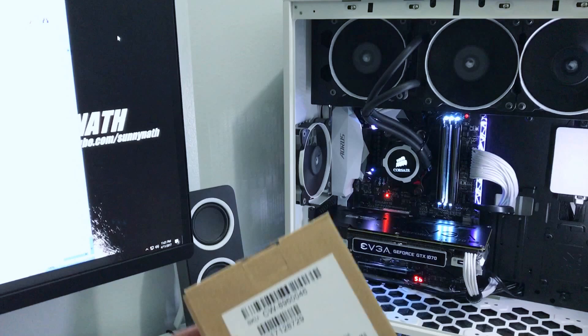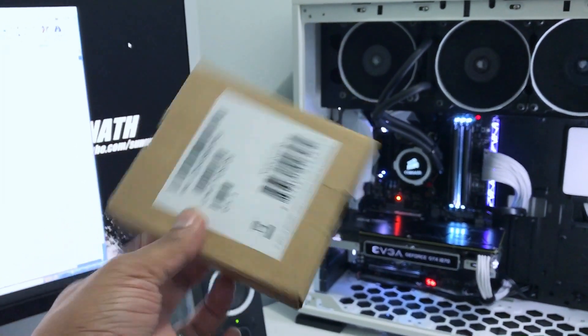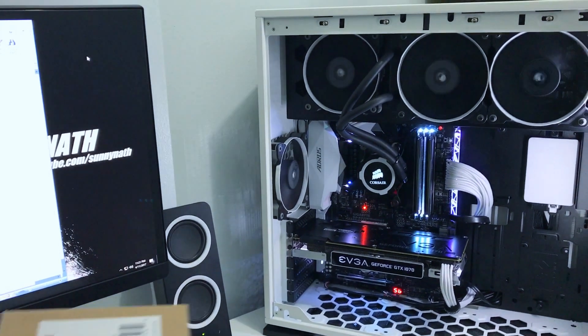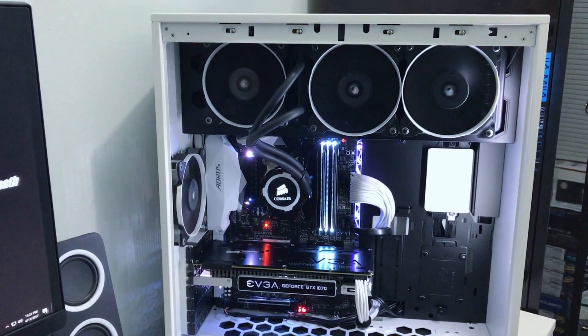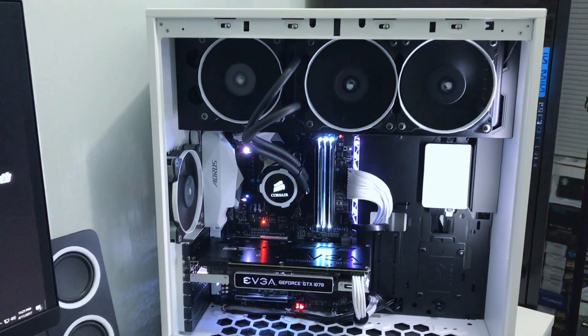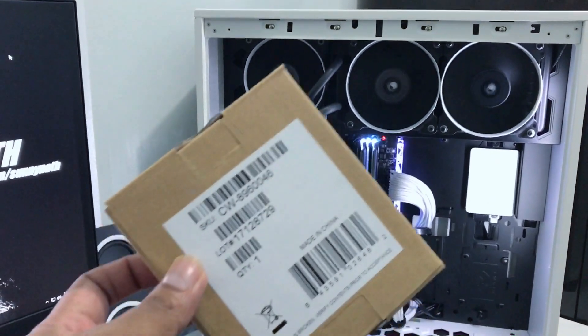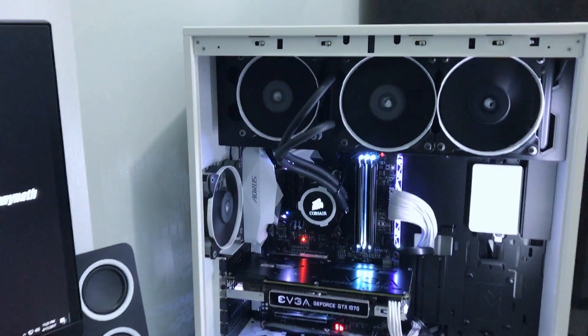I also paid $9.99 for this bracket. If you have a Corsair H105, you can install that cooler on your X370 or B350 board — all you have to do is contact Corsair and get the AM4 bracket from them. That's about it.